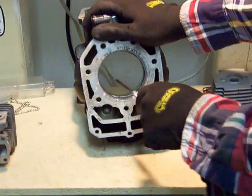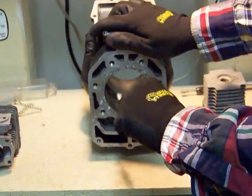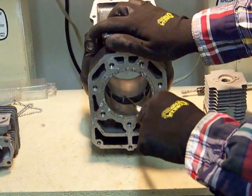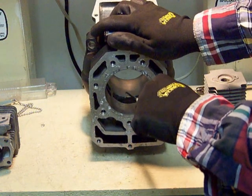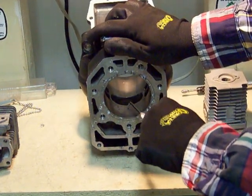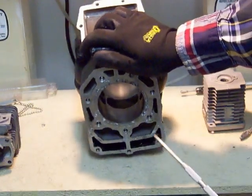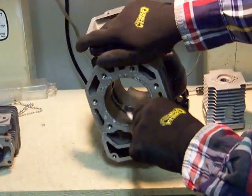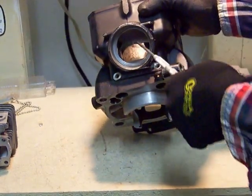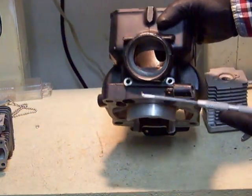The other thing to know about your exhaust port is where this upper roof is also determines your trapping volume. The upper roofs of the boost or auxiliary exhaust ports also determine your trapping volume — once the piston moves past, everything is closed out, and the air-fuel mixture can no longer escape. Once it's closed, the volume remaining is being compressed — that's your trapping volume. Moving the upper roof upward decreases your trapping volume. The boost or auxiliary ports increase the cross-sectional volume for potential airflow out of here, making it effectively bigger when you can't enlarge the main port further.